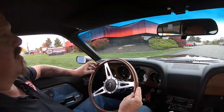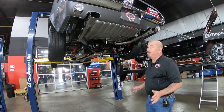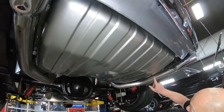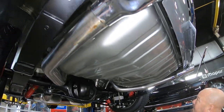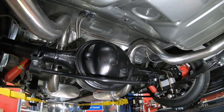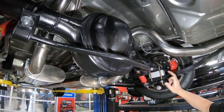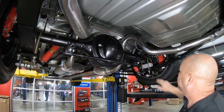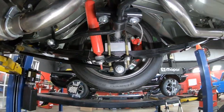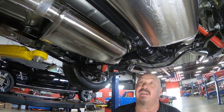Here we are at the shop right now — come on and visit us. We're under this beautiful car. They even painted the tank to match the car. The stainless steel exhaust is all polished up looking good. The whole bottom of the car is painted — it looks beautiful. We've got a sway bar on the Ford 9-inch, lowering blocks, brand new U-bolts. Looks like Wilwood brakes, drilled and slotted rotors, new shocks. 350 gear and it is posi. We even have traction bars on here — we've got to stick that horsepower down to the ground.